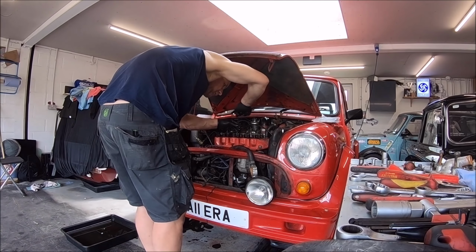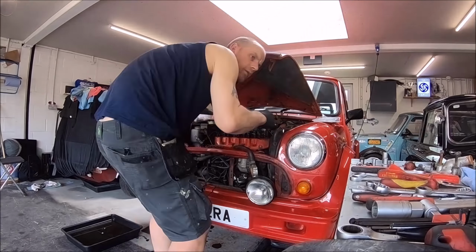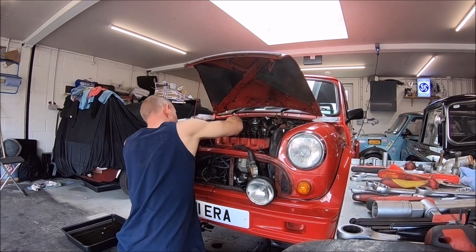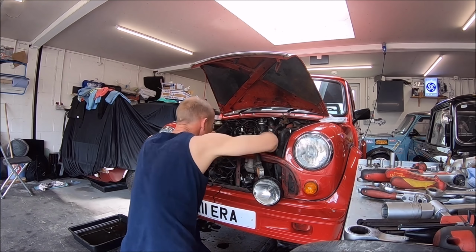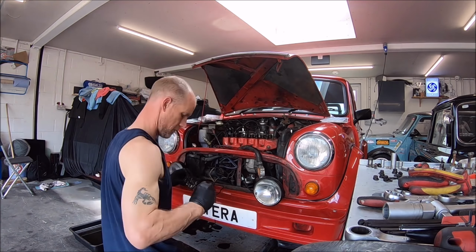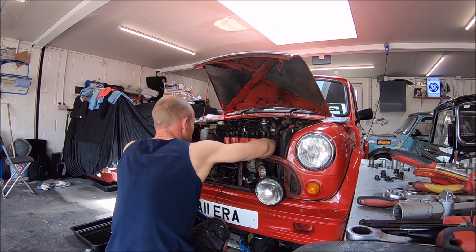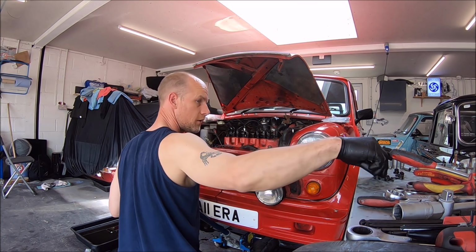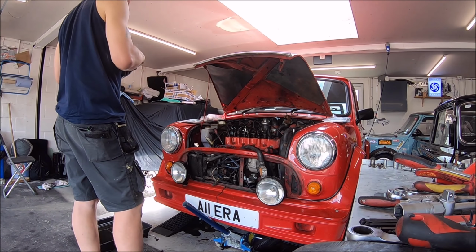So I think what happened is there was some grease or oil down the hole. It's only a 3/8 bolt that goes down into there. Mark said he tightened it up. The bolt sort of tightened up 90% of the way. He gave it a bit more effort just to tighten it up. The last probably thread and a half, I heard a crack and saw a puff of rusty smoke come out the side or end of the head, and believe it or not, it cracked the cylinder head down from where the bolt is. Now, I've never seen that before. I was absolutely gobsmacked when Mark phoned me, and Mark on the phone sounded like he was about to cry actually.